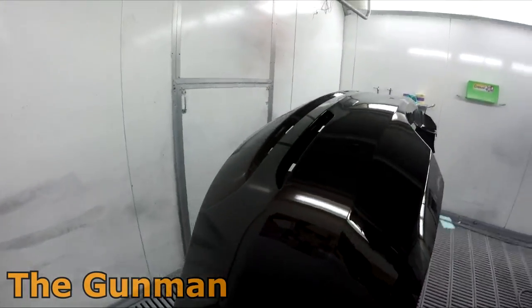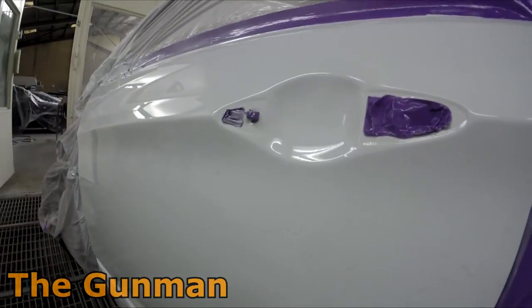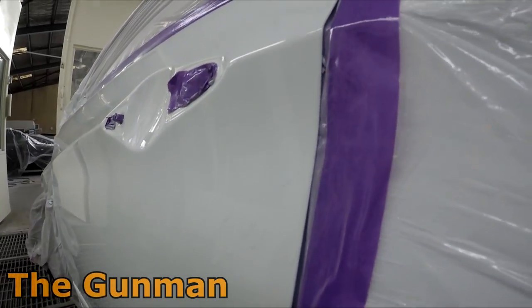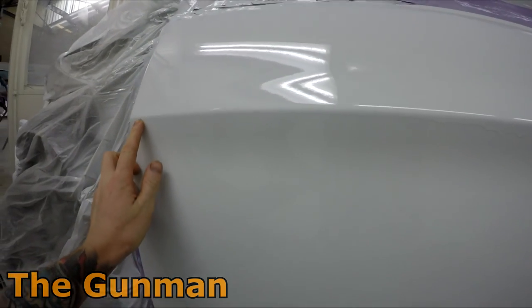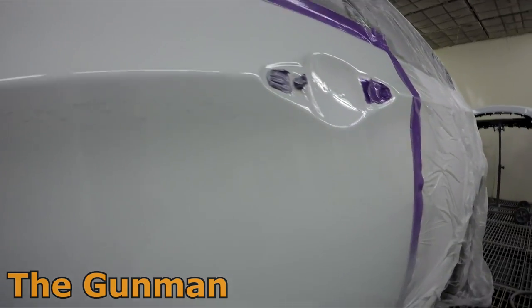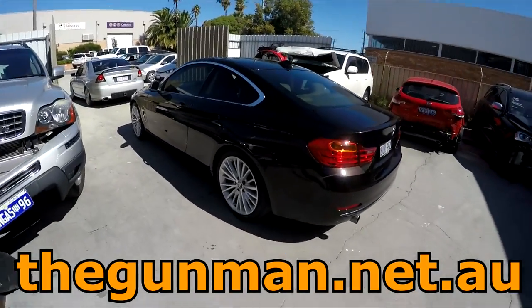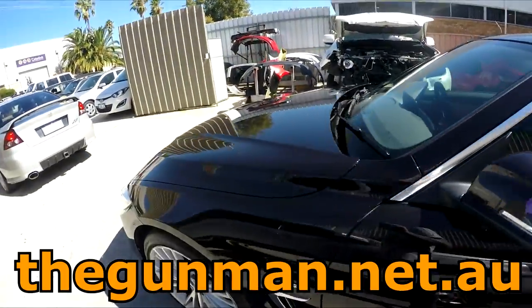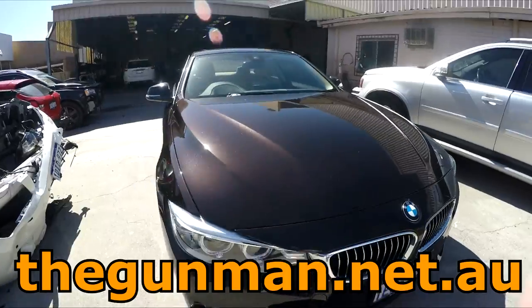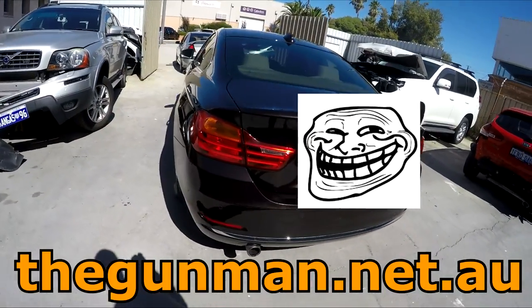All I ask is that you show Moses a little bit of respect in the comments section — it was obviously a mistake. He'd gone and changed his gun settings. I set him up and he was painting really well. What a monster run. It's even worth trying to get it out — I'll put my filler in and start blocking and see how we go. What happened is one of the other painters I work with took Moses into the booth and showed him how to do the tack and whack method, which he just saw me do on this BMW — where you just put one coat on and smash another coat straight over it. And I was sort of thinking to myself, it's probably a little bit above an apprentice. You might want to learn to walk before you run. And pun not intended now you've seen this video — get out there and paint some stuff.